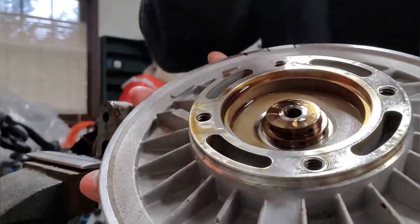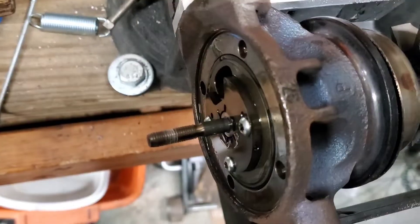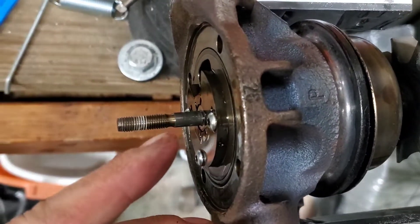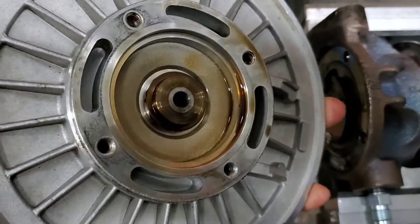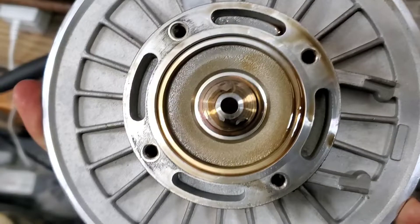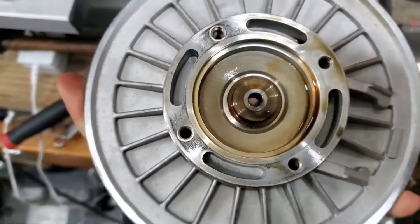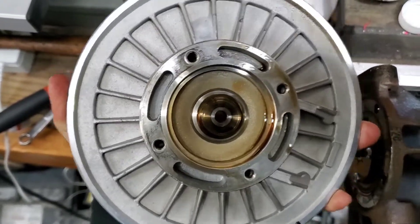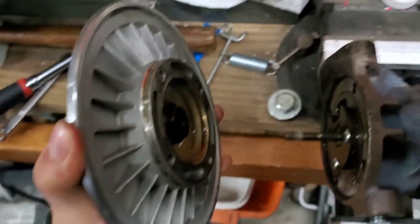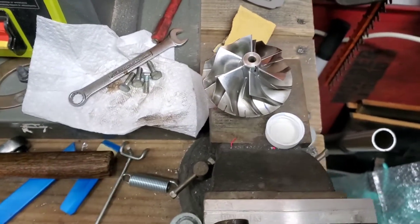You'll see one of the oil-fed bearings here — it goes right through the front. This shaft with this little indent is part of what feeds that bearing. I don't really think it went at all — they have a little bit of side play to give it an oil cushion, so don't worry. Your turbo may not be blown. There's a little side play, but if the turbo can actually touch the compressor housing, then you might have an issue.